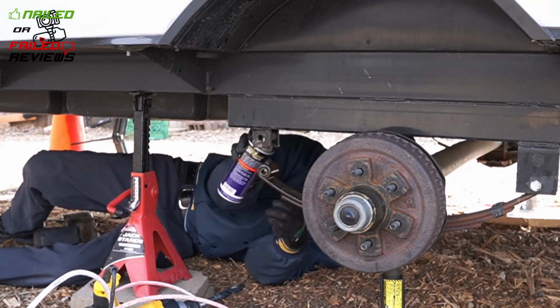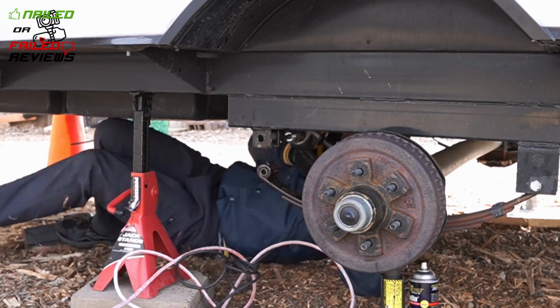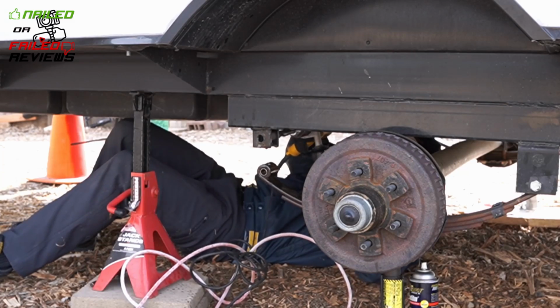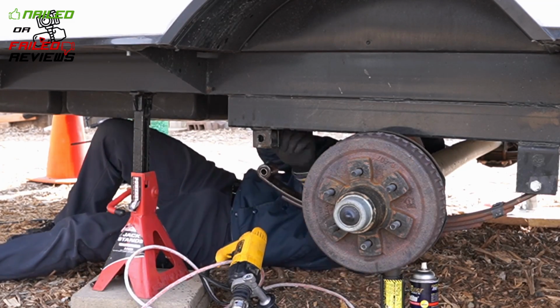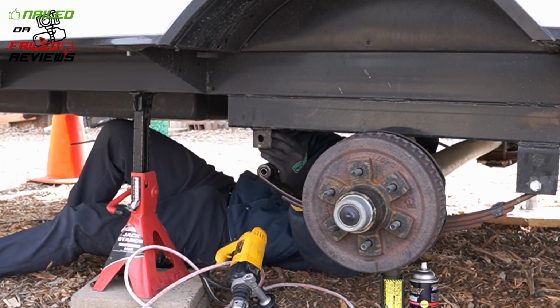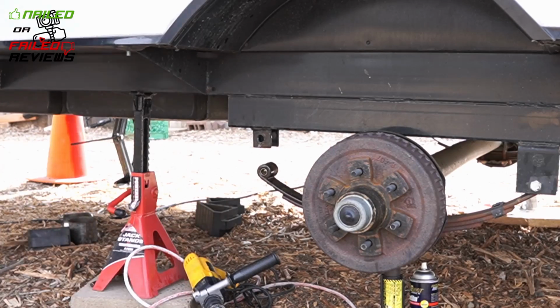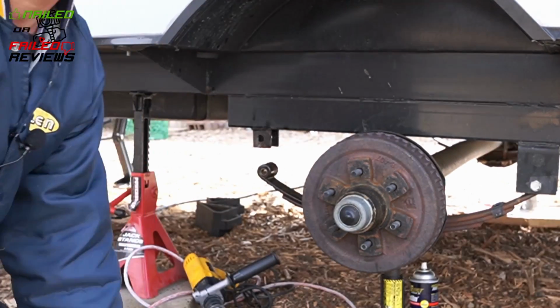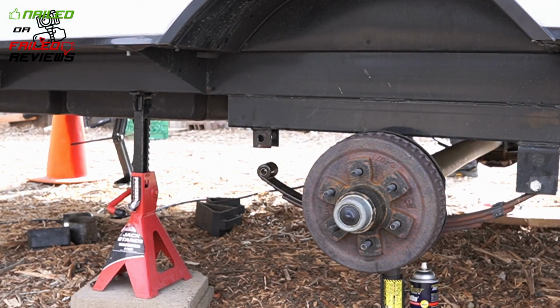So you might want to do this first and then determine what your hole size is to actually have the bushing outside diameter made specifically so you could press it in with an actual C-clamp. Now my hole, because it wasn't, like I said, super steady drilling it, was a little bit bigger, and so because I already had the bushings made, they didn't fit in super tight, but they do go in hand tight.